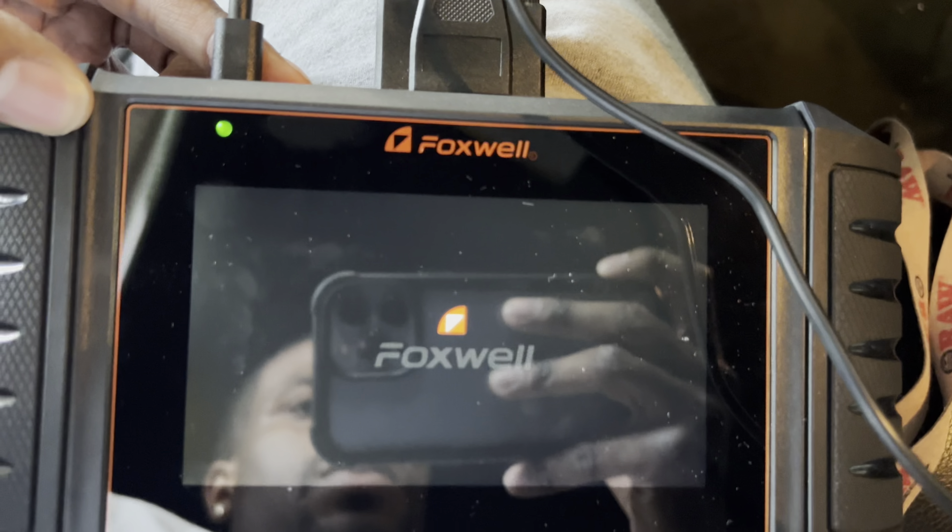Alright, let's get back and do what we came here to do. Most of you guys will probably be using this as an OBD2 scanner tool. We're in a BMW so we're going to hit BMW. We've got Smart VIN or Manual Selection - manual selection lets you pick the series, like 7 Series - but we're just going to do the Smart VIN way because it's going to automatically get my VIN number. It tells me everything: 740Li.